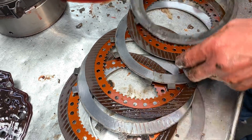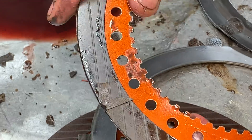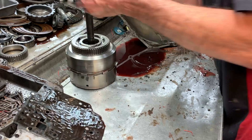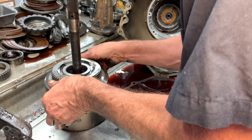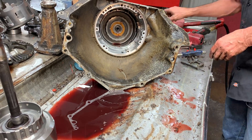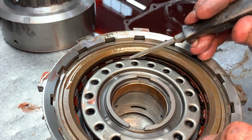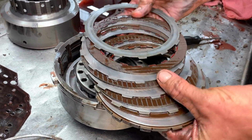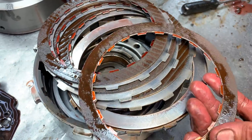You can see how big these clutches are — they're massive. You can see they're starting to flake off though. Make sure you leave your wave in there. Now here's your engine brake band. Look in here — we've got a lot of clearance in that clutch pack. That thing is going to be worn plum out. Yeah, there's no clutches left — this one here is totally flaked out too. And you notice this one here doesn't have nothing — it's totally gone.